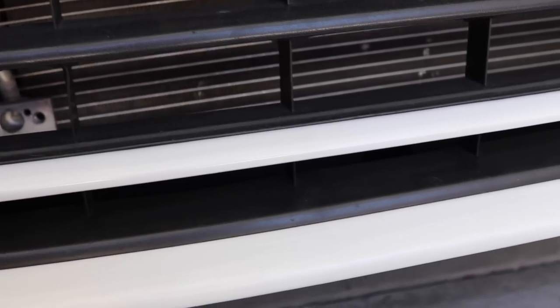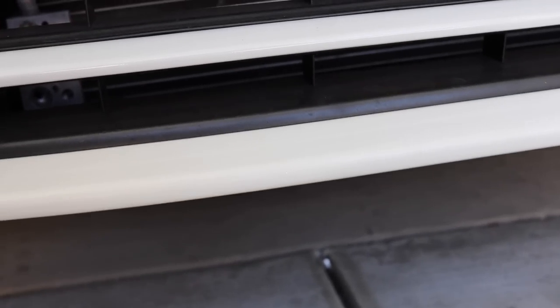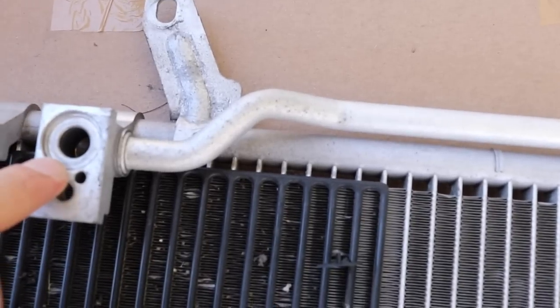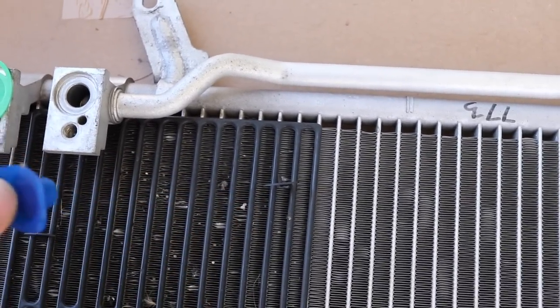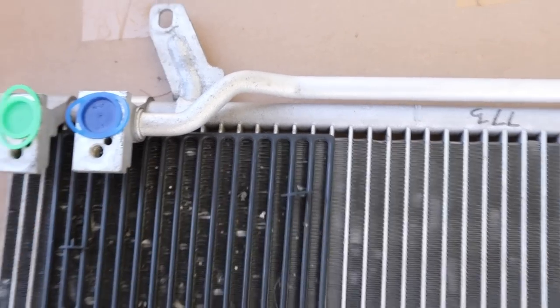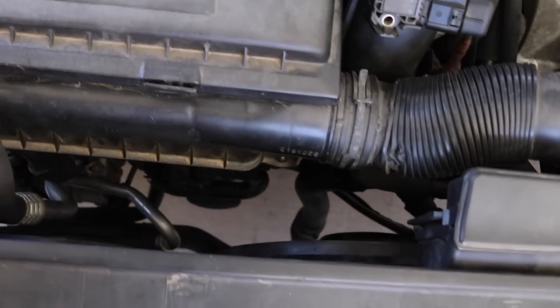The reason I had to replace it: somebody installed the wrong condenser — it fits a 2.5 liter. They bought it thinking it would work, but the AC lines are just hanging because they don't fit — it's a different bracket system. You can see this one has a flat face where those AC lines connect and that's where the sealing surface is. The current one just has a big gaping hole and seals in the back, so those two lines don't work together.